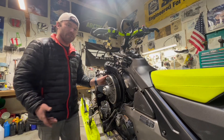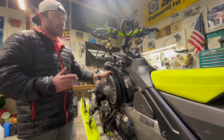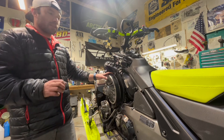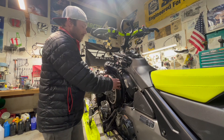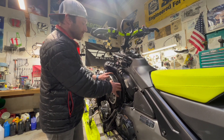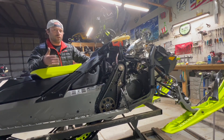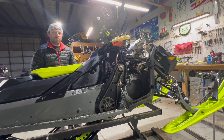Another way to tell if your chain is loose: we can rock the secondary clutch back and forth and you can feel the slop. Normally I just tension the chain by feel, but if you have the clutch cover off it's a good thing to check. See the track isn't moving, but you can see the slop in the chain right here. As I rock the driven back and forth, now you can visually see what you're feeling in the driven clutch.